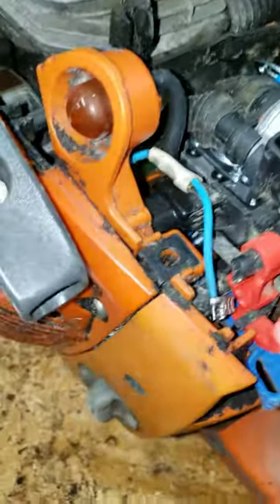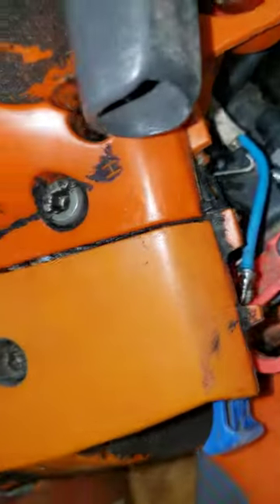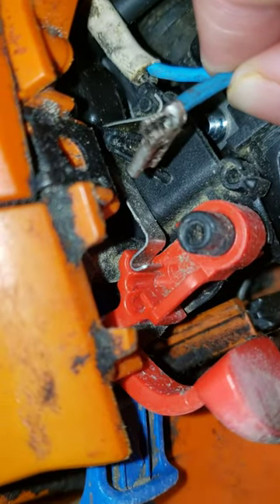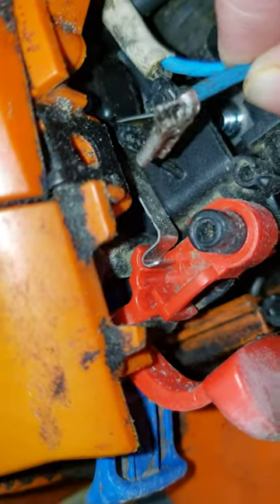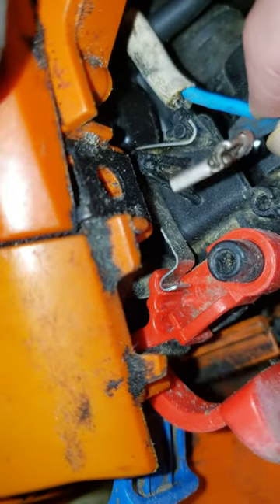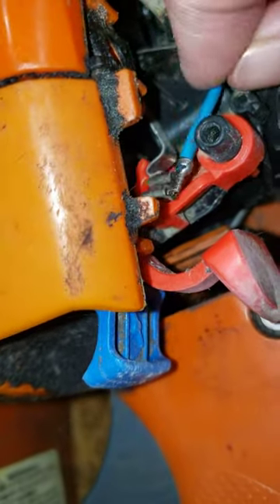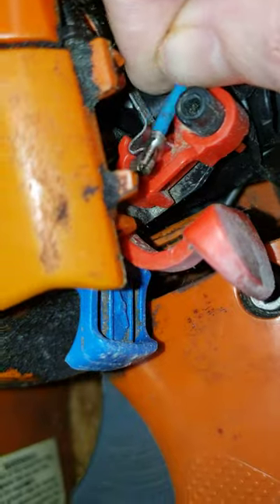As far as the end of the clip, it actually clips into the side of the stop switch. You'll see the piece of metal — that's actually what makes connection with the end of the wire when the switch is depressed to turn off the chainsaw. So it basically slides in front of that piece of wire.